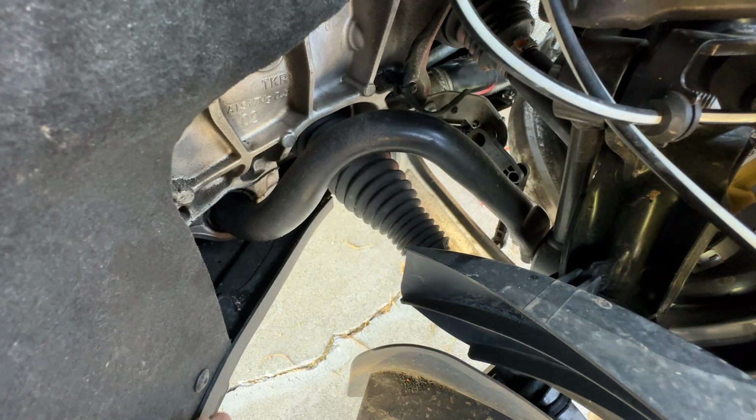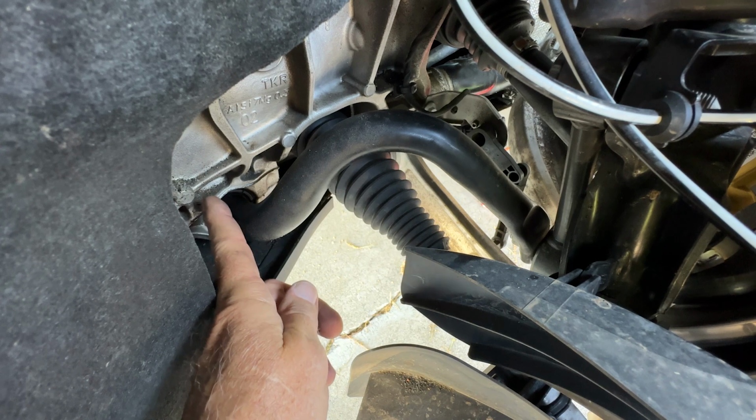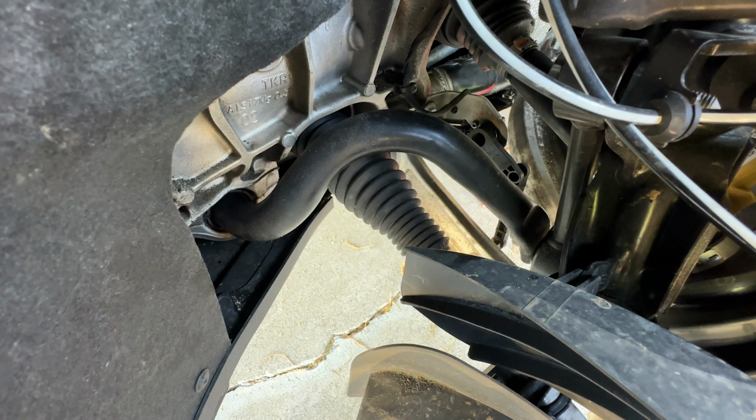Now this is an active stabilizer bar, but we're not going to see that. The mechanism is in there in the middle of the vehicle, so we're not going to see it. But what that does is allows a computer to either overdrive or underdrive the stabilizer bar to flatten cornering or to let the opposite sides articulate, depending on what's needed.